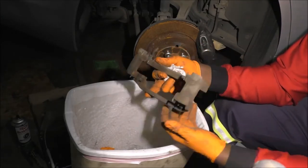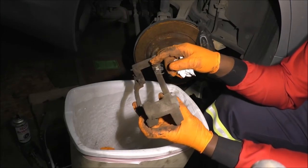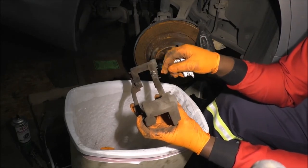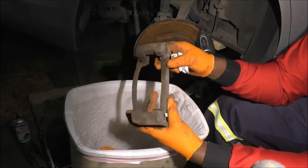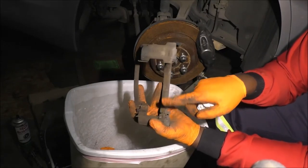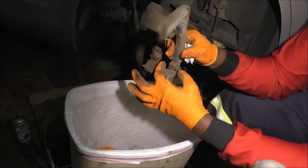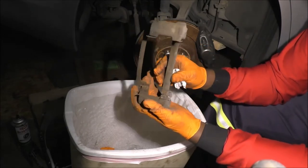The other thing with these is that you have what they call slide clips, brackets, noise abutment clips. These, being machined, smoother than the cast material you see here, are supposed to allow the pads to slide back and forth on them. As you can see, being shaped like this, a little narrower here, they would naturally try to push the pads back out. So pay attention to these.